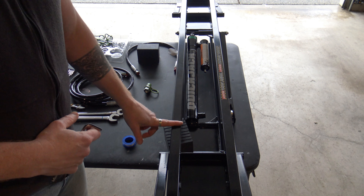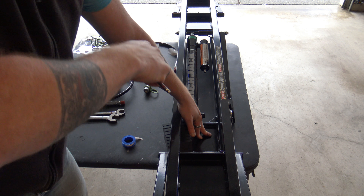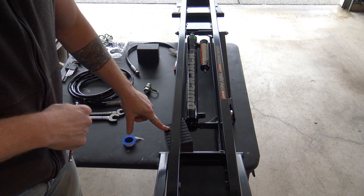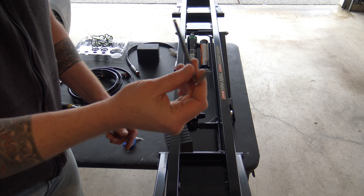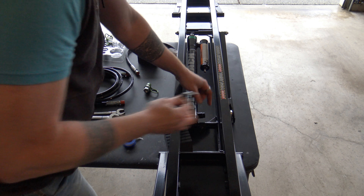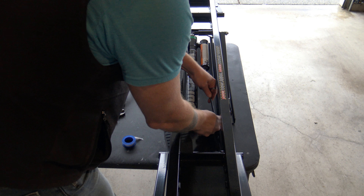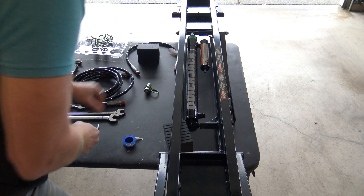The first trick I've done is I've separated the rails — you can put one hand down low, one hand up high and lift, get some space in between, and put a block in between the two, one of your lifting blocks. That way you get a little bit of extra room to work and it makes it a lot easier to work with your Allen wrench. This is the 6mm — you're going to take out this little plug out of the cylinder.